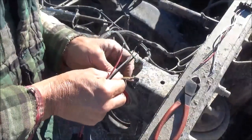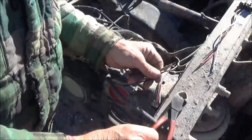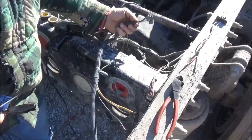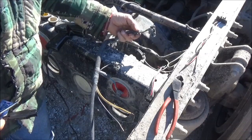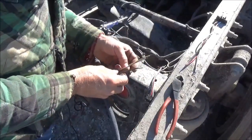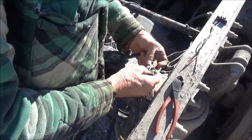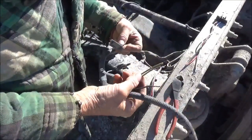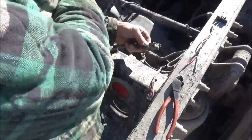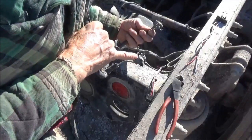Now I don't have a color code to match up, so I'll have to go inside the truck and get a test light, turn the lights on, and test each one of these wires to find out what it is. This one I can match up — the colors are going to be different, but I can match it up. This one here has a white wire, which is probably my ground, because we got a white wire on this side. This one goes to my left side where the lights are, and this one in the middle goes to the backup light.